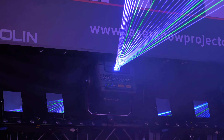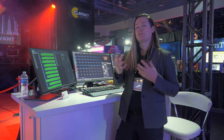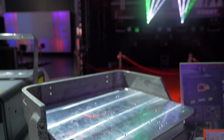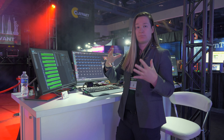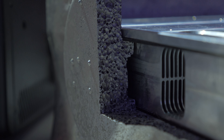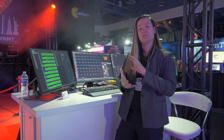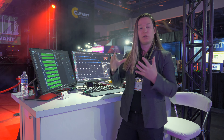The new Atom and Spectrum come in this new case, and a lot of people have been joking about it looking like a cooler, which it kind of does, so that's fair. But it's using this revolutionary material called foam aluminum. It's a self-oxidizing aluminum material that we put inside of a mold. When it's heated, it expands into the mold and creates the shape that we want for the projector. This introduces air bubbles inside, allowing it to have a lattice pattern for strength. However, it's significantly lighter than having a milled aluminum chassis, so you have this significantly lighter enclosure.